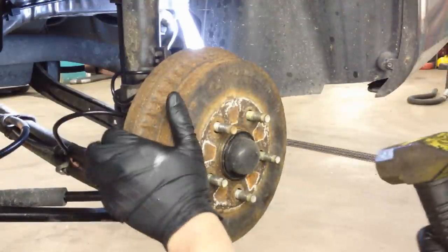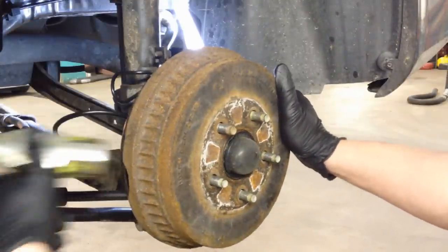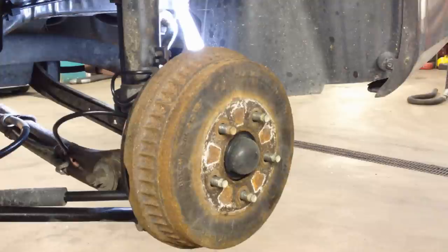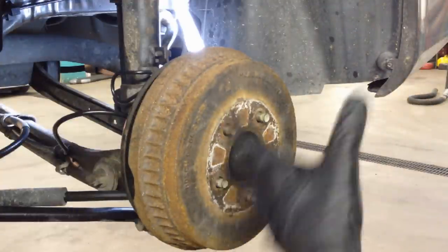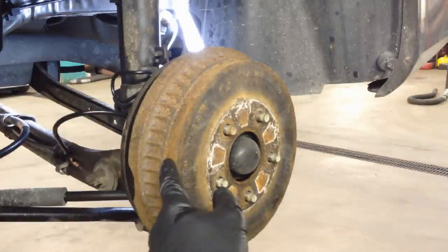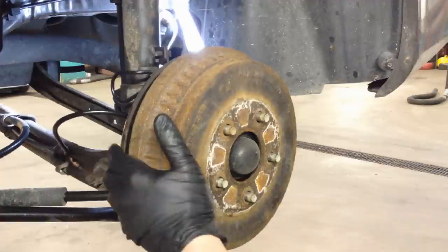It's coming out a little bit on this side, so hold this side so it doesn't collapse back in, and start tapping on the other side. Now the other side — the passenger side — it locked up and ate right into the drum, wearing the shoe right down to the rivets, so that side is just toast with tons of black brake pad material in there. If these don't malfunction, they usually last about 140 to 160,000 miles before the shoes start going into the drum, at which point you need to change the drum anyway.